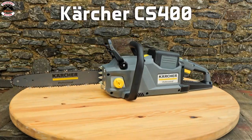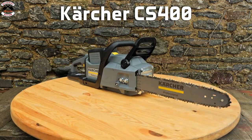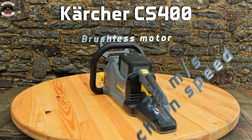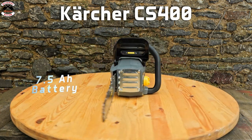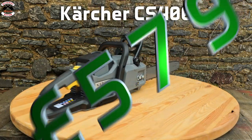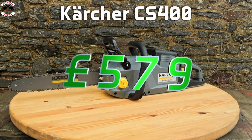The Kärcher CS400 is running a 3/8 chain, which is 1.3mm. It's a 36-volt system taking the one battery, the motor's brushless, and it's a 23 m/s chain speed. It's running a 7.5 amp hour battery, the decibel rating is 105, and it has a recommended retail price of £579, including the VAT, as a kit.